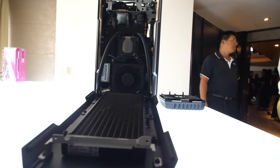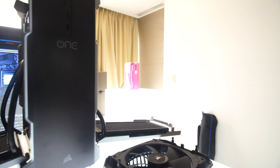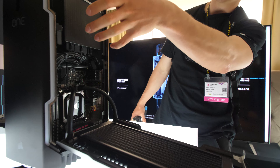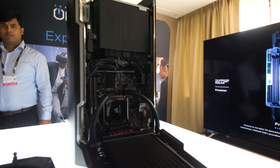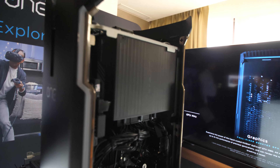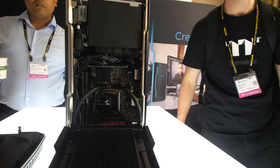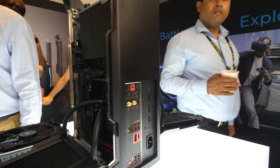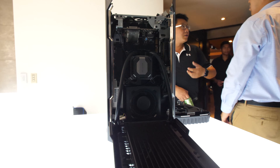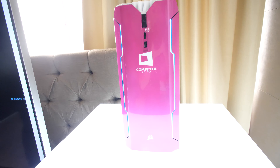On the left-hand side is where we have most of the other components. We have the SF400 at the top, coming down to a Mini-ITX MSI motherboard — it's a custom motherboard mostly because capacitors need to be in certain places, not in the way of cooling or cable management. We have a 480GB SSD and a two-terabyte hard drive in this model. It uses normal desktop memory — two Vengeance LPX sticks — and a desktop i7-7700K CPU on a Z270 motherboard with a normal desktop video card.